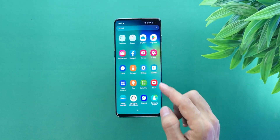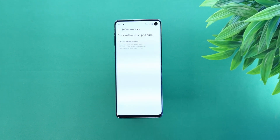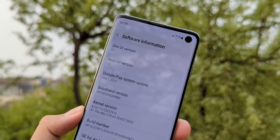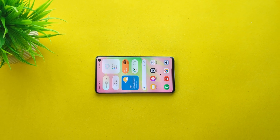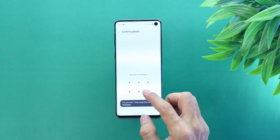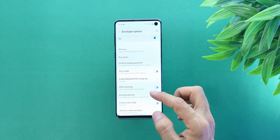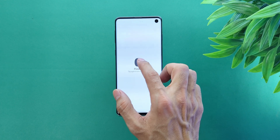Alright, here we go — follow me step by step. First step: we need to unlock the bootloader. Check for any software updates first. If there's one available, go ahead and install it. If not, you're probably already on the latest official version. If you're already running a custom ROM, skip ahead, flash the repartitioner and cleaner files, then the ROM itself using TWRP. But if you're on stock, let's go. Go into Settings, About Phone, Software Information, and tap the build number seven times — that will unlock Developer Options. Go back to main Settings, scroll down, and look for OEM Unlocking. Enable it. Done. Then shut the phone down.